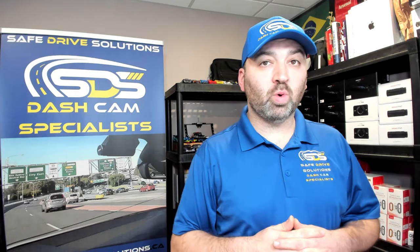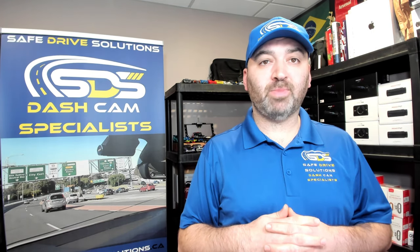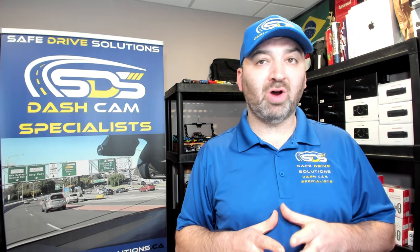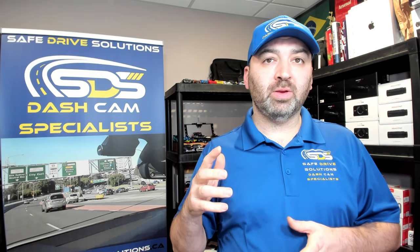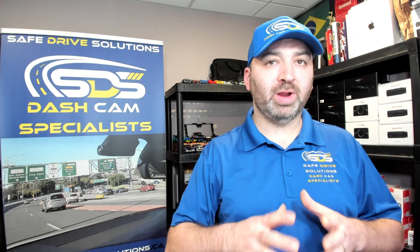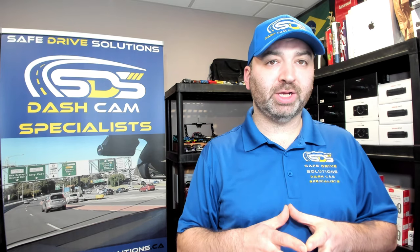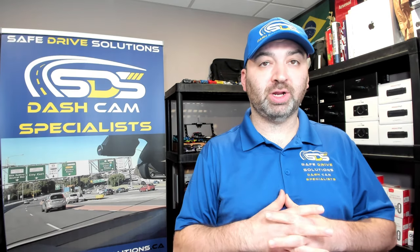Parking recording duration. If you have parking mode turned on, it means the camera will keep recording until the hardwire kit cuts the power supply. If you set it for 1 hour, it means the camera will shut down after it gets into parking mode for 1 hour. Keep in mind, the low battery protection trumps everything. So if it drops below that set voltage before the 1 hour, it will actually shut off.